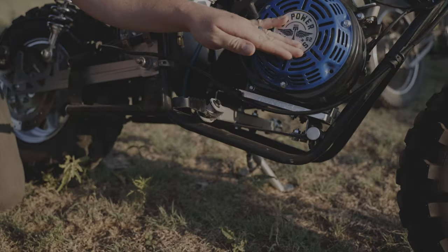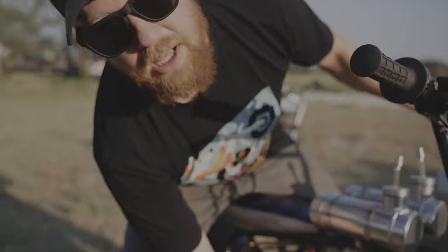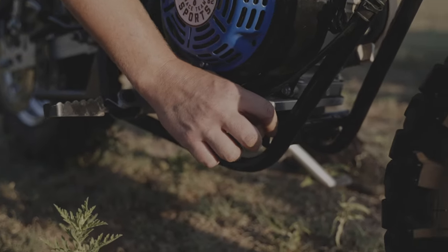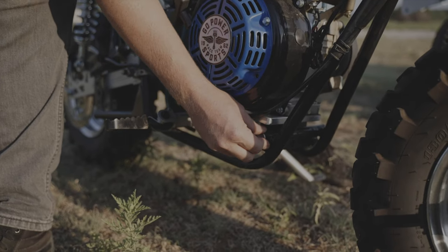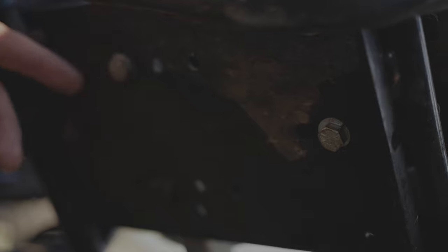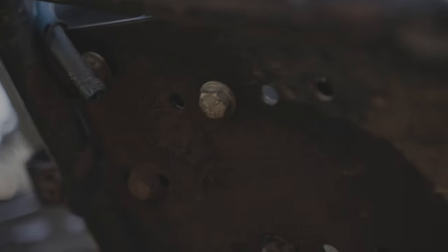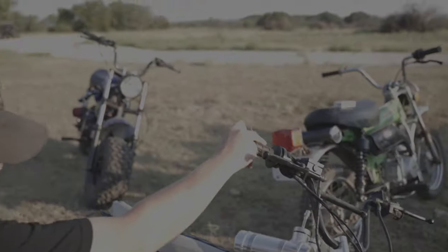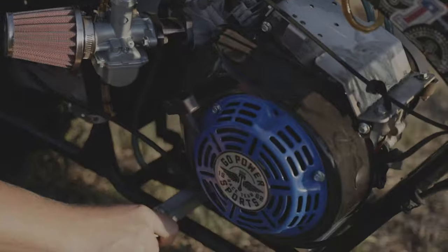You have this tilt mount that lifts your engine above the original motor plate. What we did on this one, we just cut this off — you don't want to lose that whole bar because it's kind of a brace for your frame, so we just cut these off flush and put a little plug in there. All you have to do is get under here and drill holes in your frame. We did like four sets so we could move it back and forth — that way you can really dial in where you want them to be for your specific riding style. So you need the tilt plate on the 8105, drill your holes, bolt it down, and you're ready to rip.